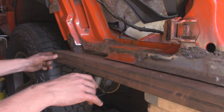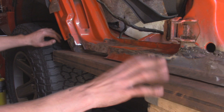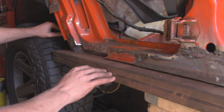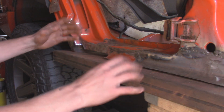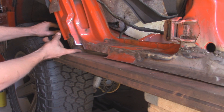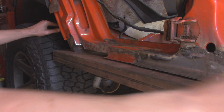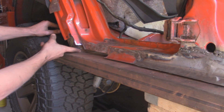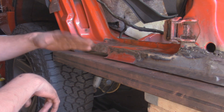Alright, so we got our 2x6 piece of steel mocked up in here for now. This isn't the exact one I'm going to use — this is one from when I did my last Jeep, but it's a lot smaller. I got some new stuff we're going to be using later, but it's good for demonstration purposes on how we're going to be able to fit this. As we're cutting out the sheet metal, there's going to be a lot of putting this into place and taking it out, cutting a little bit more. I just made that cut in the rear and I still have to go up higher — it's up flush with the existing rocker up here in the front. But as you can see as it comes back, we'd have a gap forming because it's contacting the rear plate back here. So it looks like we have three sixteenths to a quarter inch we got to cut off, so we'll cut that off a little bit more and then work on the front.